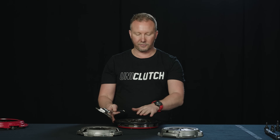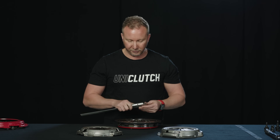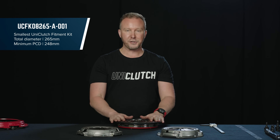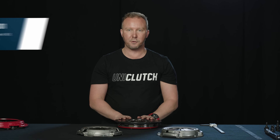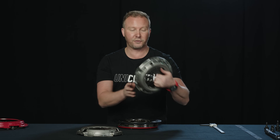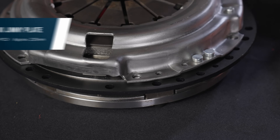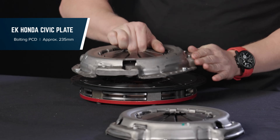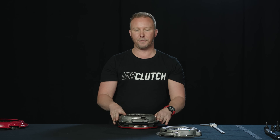The Lotus uses the smallest flywheel mount in the range — the 265 — so the total size is 265 millimeters. The smallest bolt-up PCD on this flywheel mount is 248 millimeters. If your pressure plate has a bolting PCD smaller than 248 millimeters, you won't be able to find a drill pattern on this flywheel mount. For example, here's a clutch from a Suzuki Jimny — if we put that here and line up the holes, you can see the bolting PCD is smaller than the flywheel mount, smaller than 248mm, so that's not going to work. And here's one from an EK Honda Civic — again, the holes are inside those of the Lotus, so again it won't fit.